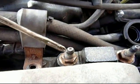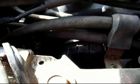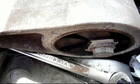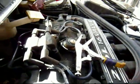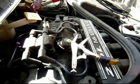Alright, we got to make sure the center of this bolt is 4 11/16 from the center of this hole, I guess. Which it is, so that means I can tighten down that to 85 foot-pounds. Also, if I didn't mention, I torqued down the spark plugs to 20 pounds.